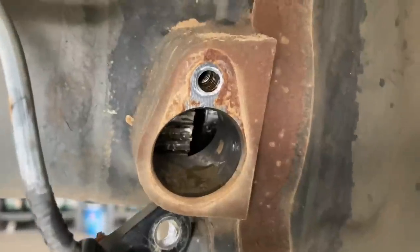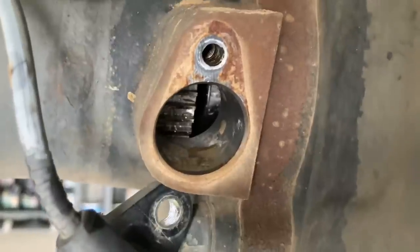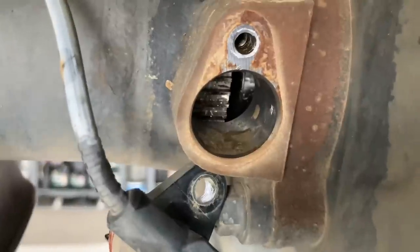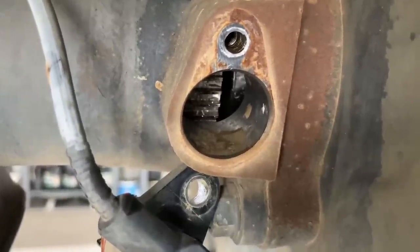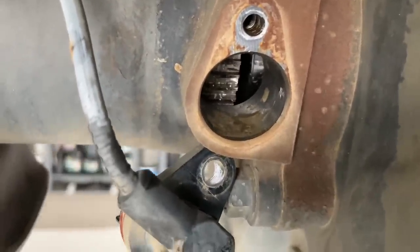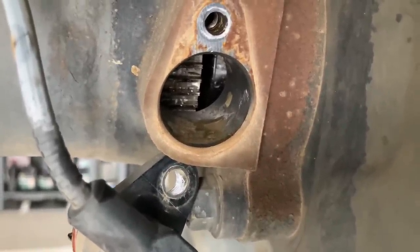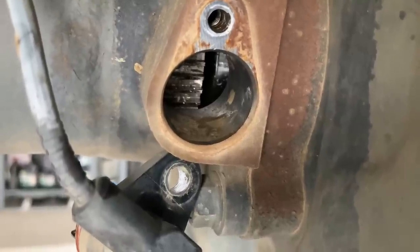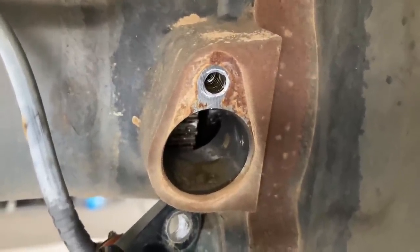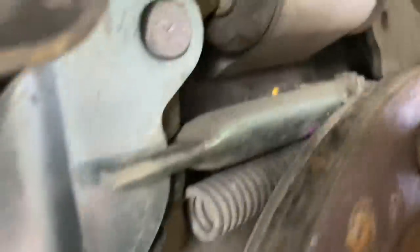If there's pressure pushing to one side you can squash an O-ring more on one side and have not enough pressure on the other, so just make sure it's nice and neat in the center and hold it there as you do up the bolt. Molykote helps it slip in and centralize. I can't see water having gotten in anywhere else. There's a seal in behind here - that stops all the diff oil staying on the left side to only lubricate the center, all the bearings in there. This is a sealed bearing out here.